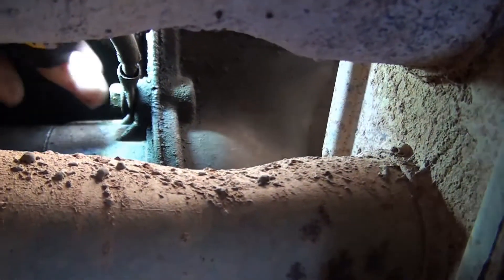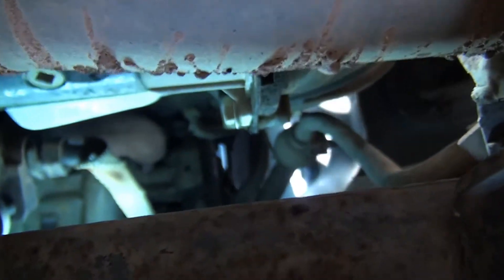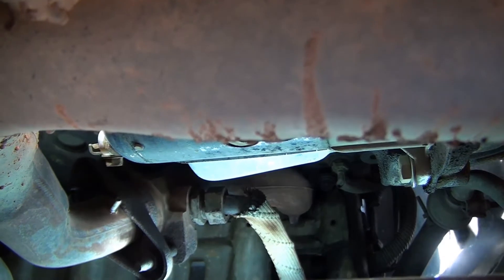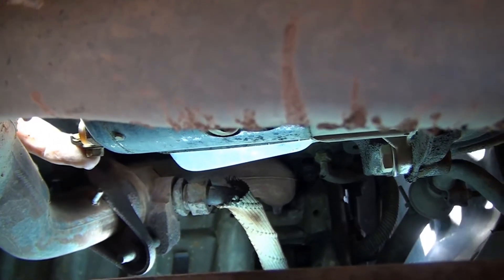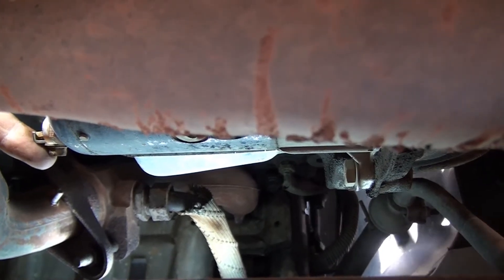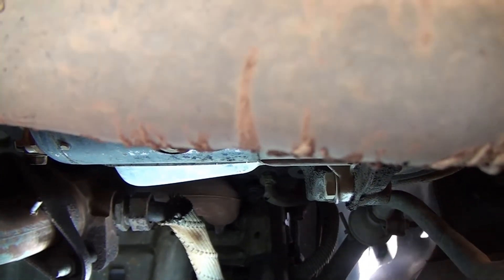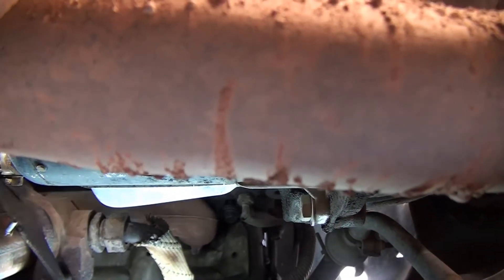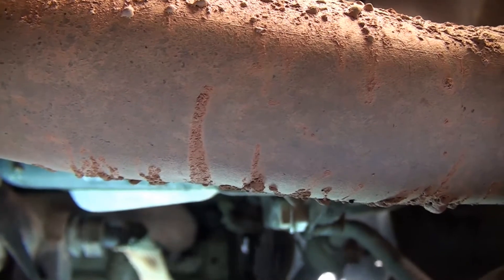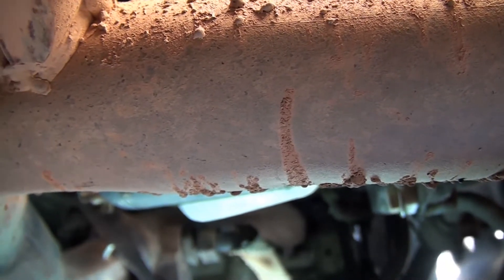There's a cable that goes to this bolt right here on the bottom — that's one of the bolts that holds the starter on, and the other bolt is right there. Right towards the back is another cable that actuates the Bendix — it's a gear that is thrown forward, catches the flywheel, turns, and when the flywheel turns it releases, and the engine's running on its own. I'm going to remove this one first because it's holding the cable. Cable looks good, by the way — you want to check your cables, because a lot of times it could be a cable problem.